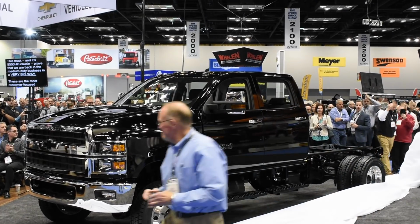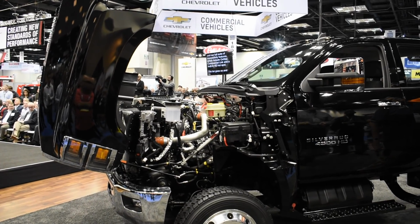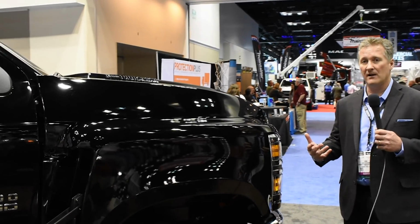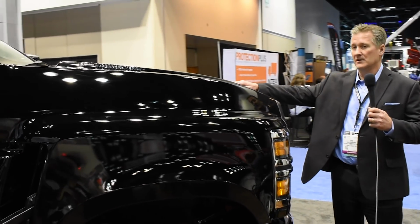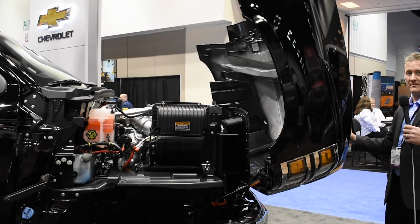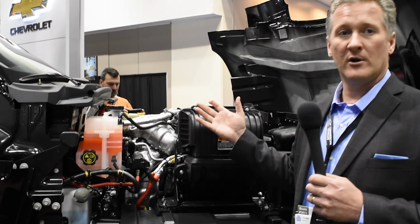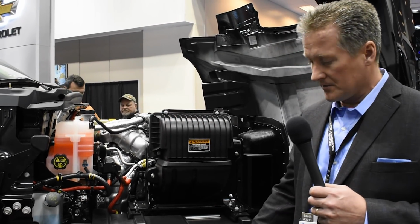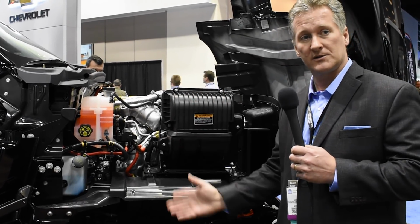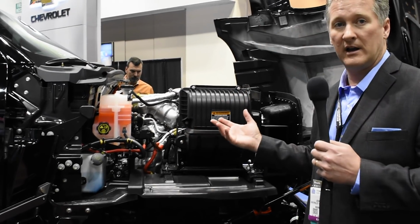Let's talk a little bit about serviceability. Routine service will be needed on these trucks, and the key part is when it comes time to service the engine, access to the engine is really important. We have the only truck that has a clamshell hood design. With one hand, you can open it up, walk right up to the engine, and perform routine maintenance. The wheels themselves have a 50-degree cut, which means if you turned the wheels full tilt, the wheel will get out of the way. I can walk right up to the engine compartment and start working on it.